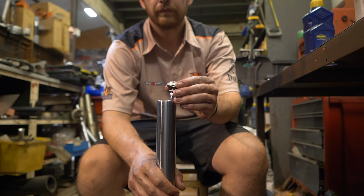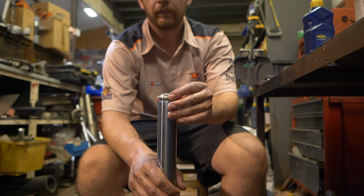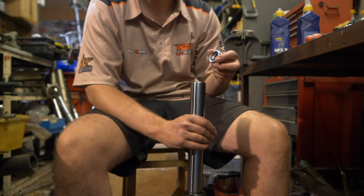So after the damper rod, we had a low-speed damping unit. Again, this is another oil control system. In our forks now, we've got two different types of control: low speed and high speed. This is where you'd notice it most on the road, in the light going stuff, especially your sags. That's quite an important aspect of suspension, having that low speed control exactly right. Okay. After that, we put the preload spacer in.